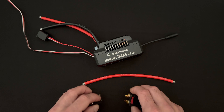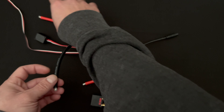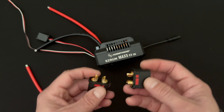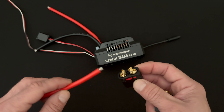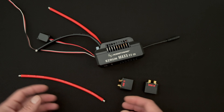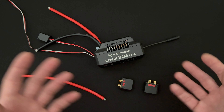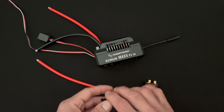A basic series wiring connection is straightforward: the negative of one plug goes on the negative wire of the speed control, the positive of the other plug on the positive of the speed control, and then the two remaining terminals are connected with a jumper wire. For big power setups, make sure your plug surface is at least as big as the wire. If the plug material is smaller than the wires, that's not enough plug for the power these systems will pass.